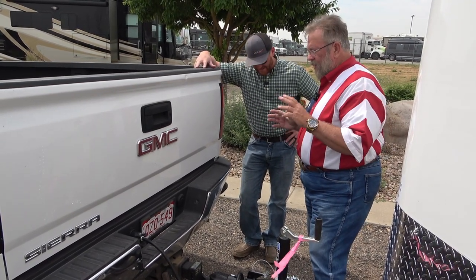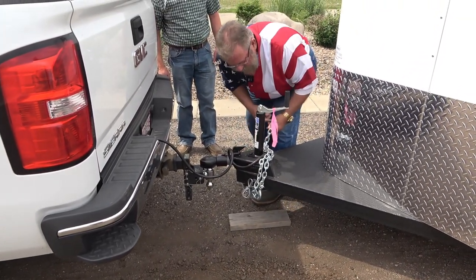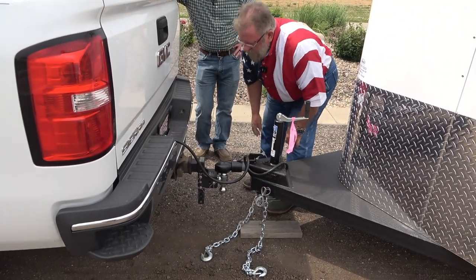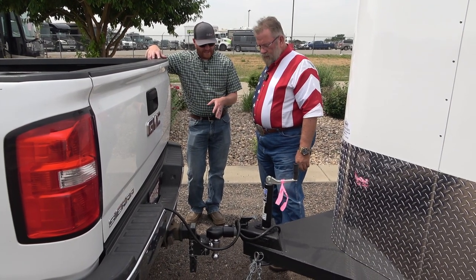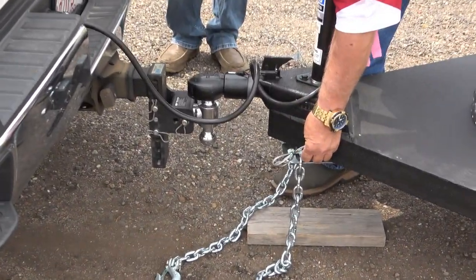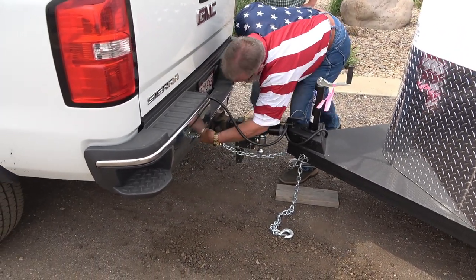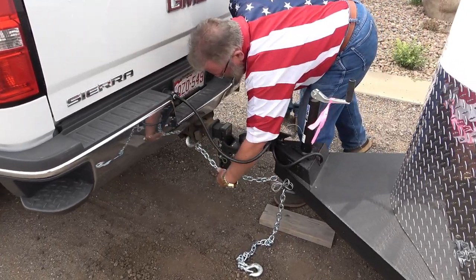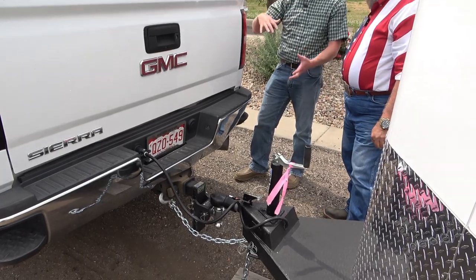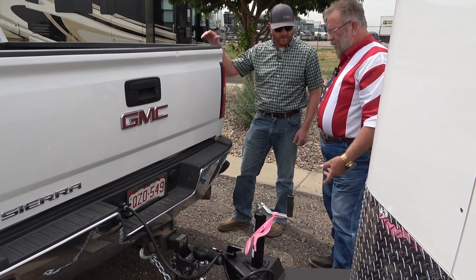It's always important to check the lights, and you guys have your breakaway too. You cross the chains if you have enough chain link — I will always try to cross them if I have the length. If I don't, then we go straight into the truck. This has a cable for the breakaway; usually you loop that either over the chain or over the other part. That hitch is hanging down with about a seven-inch drop — I wouldn't be comfortable with that, as you turn the truck and trailer are going different directions, which stretches that chain and can get tied up.